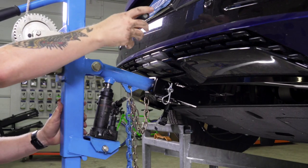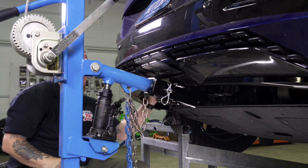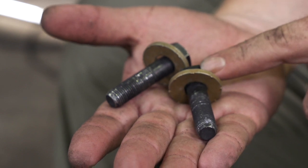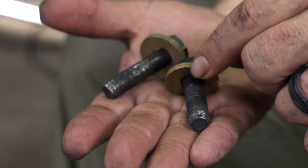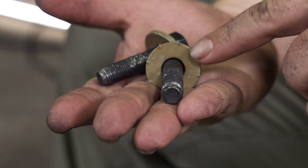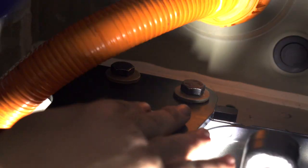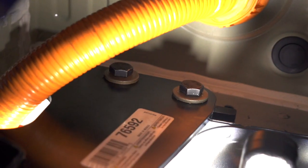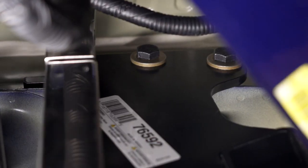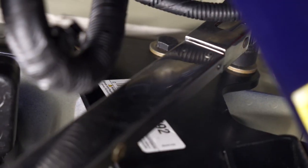Today we're gonna be using our U-Haul exclusive hitch jack. If you're installing this at home, please get an extra set of hands. We've got a total of six M12 19-millimeter bolts with six conical tooth washers. When installing the bolts, we want to make sure that the teeth on the inside edge of the conical tooth washer face the hitch. We've got our six bolts inserted — they were a little difficult to get in so we recommend getting them started. Now we're ready to use our 19-millimeter socket and torque them down to manufacturer specifications.